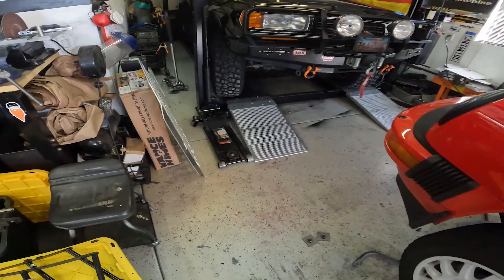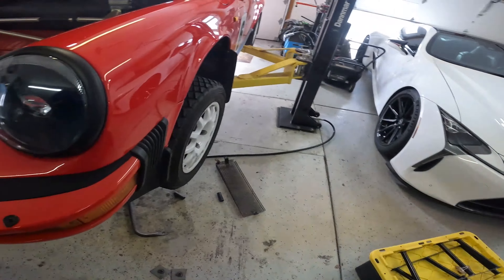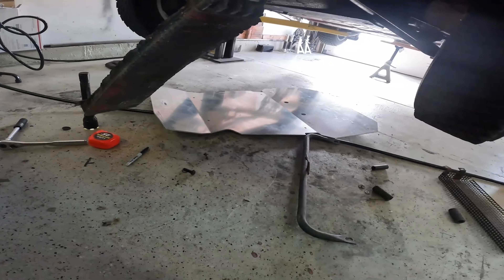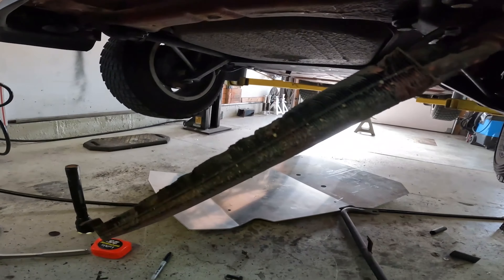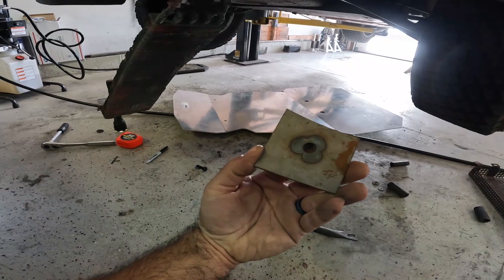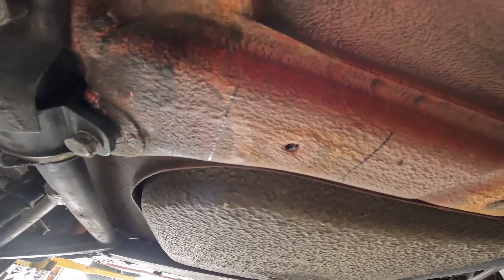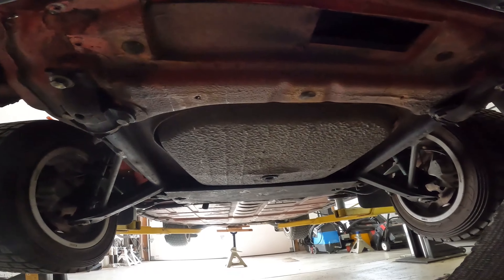Today's project is getting these skid plates on the Porsche. This is the front one. I've already started to disassemble some of the pieces — this little cooler guard that actually needs to come off in order for that skid plate to fit. And I'm marking these little weld-on plates for the front mount now. You can see those are gonna go right there. Of course, got to be careful because that right there is the fuel tank.